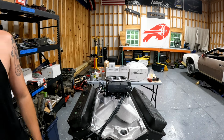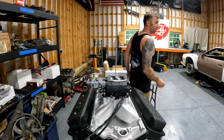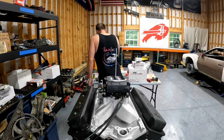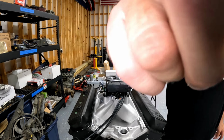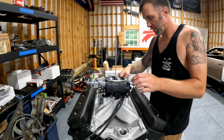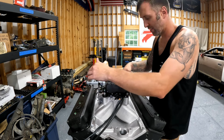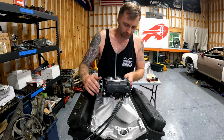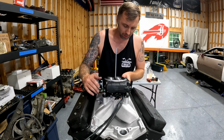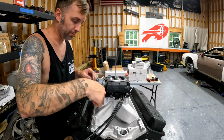They put the lime on the coconut. Still getting anti-seize all over the place. All right, well, we can get this unit snugged down, I think. What size is that, half inch? Booyah, first try. Start bringing these nuts down here. Like I said, as you're doing this, just gradually be moving these butterflies. Make sure that you haven't put the carb in a bind, and you don't want to over tighten these nuts at all. So what I'm going to do is kind of crisscross, snug them down lightly.